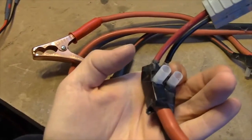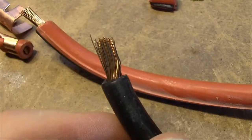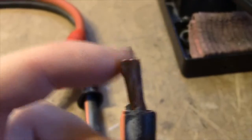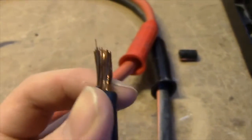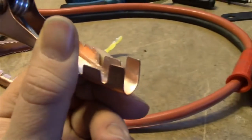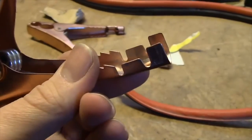Just gonna give this a quick check. I don't think I'm gonna redo this connection — maybe re-cut the wire, if that. Looking at these cables, it's pretty apparent that they are of horrible, horrible quality. We can see how they've oxidized on the inside of the cable, which isn't really that big of a problem. But due to that, I've decided to clean these up quite a bit, and to actually solder the cables in place after I crimp them, because I wouldn't want any oxidation to occur in the crimp after it's been crimped, which would increase the resistance of the connection. Got a strong soldering station for a reason.